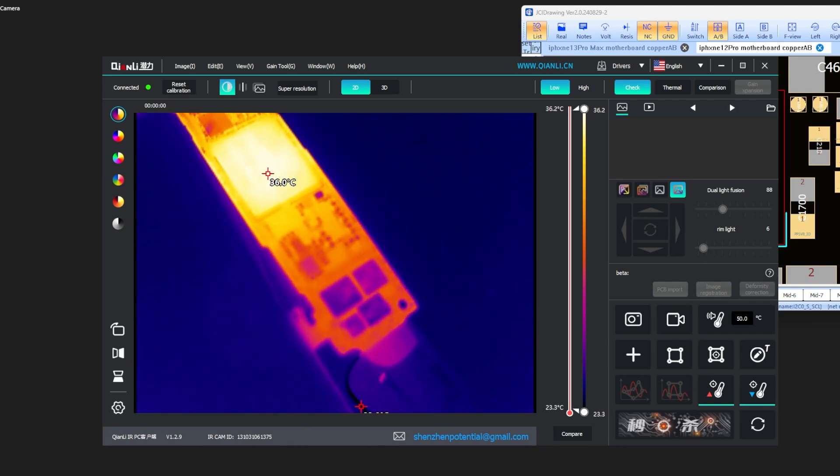I'm going to have to end it there because we need to order that part. As you can see, we were able to slowly troubleshoot back to what I hope to be the final component to getting this phone working again. Without that EEPROM connected, we automatically get the boot loop because that circuit isn't being pinged properly throughout the booting process. Luckily, that is a replaceable part. If you have any questions, leave them in the comments below. Probably a follow-up next Friday — hopefully the final part three. Make sure you're subscribed so you don't miss out. Thanks a ton for watching and we'll see you in the next video.